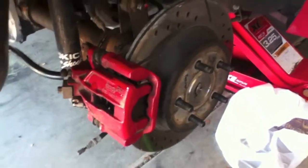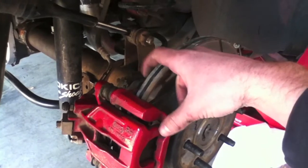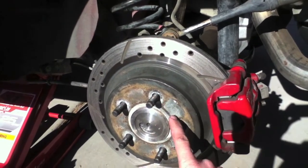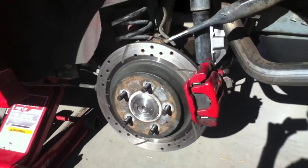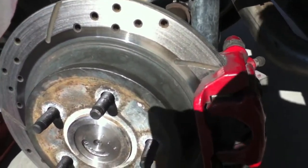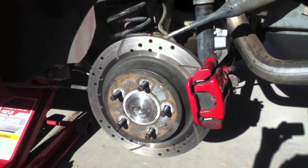On my brother's Mustang Bullitt, the shafts were a little bit shorter, so it was scraping on the inside — kind of hard to tell what was going on until we looked behind there. I just put two washers on each side, went down to the hardware store and bought them. Stack them until the problem goes away — it was like 80 cents for 12 of them, so it's a relatively cheap fix. On this side it doesn't look like it happened quite as bad, but the other side was completely rashed. So that's just something to know about, and I hope it doesn't happen to you, but it might.